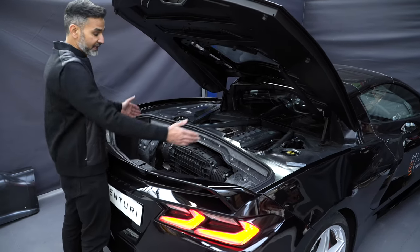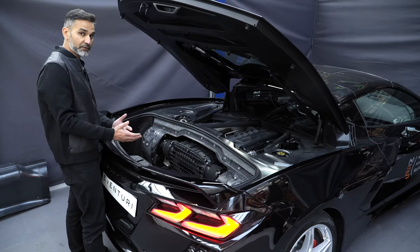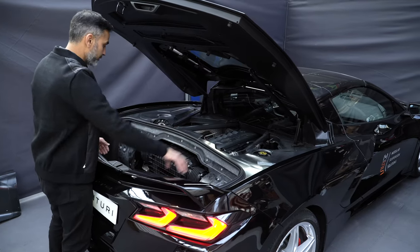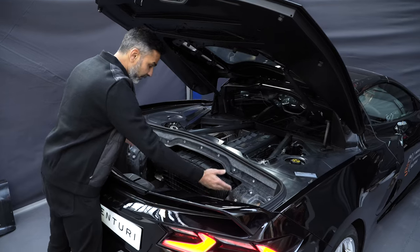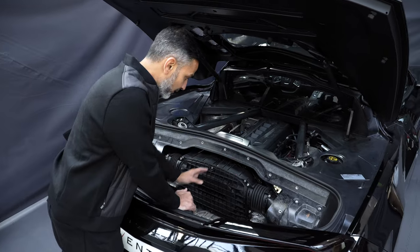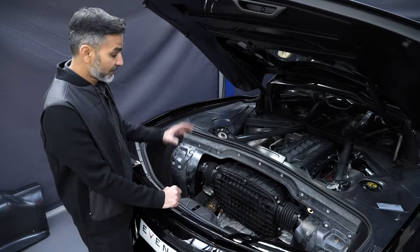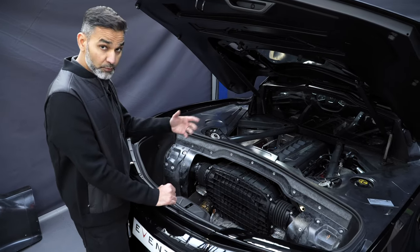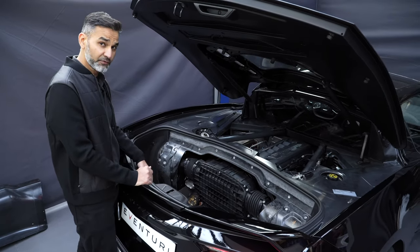The cold air is taken in from the sides. There isn't actually a direct channel to those ducts, but there is ambient air in those areas. So it has a good cold air feed pulling in from both sides to the middle of the airbox, then through a large filter to the MAF tube and then to the throttle body. That's a brief overview of the airbox as installed.